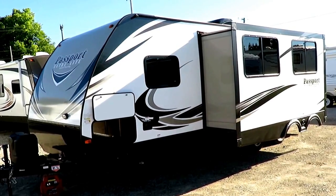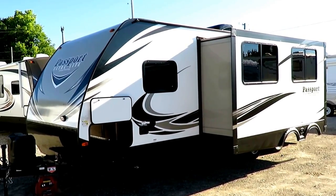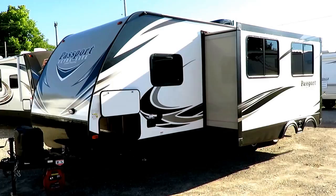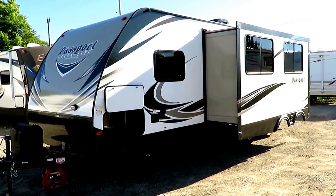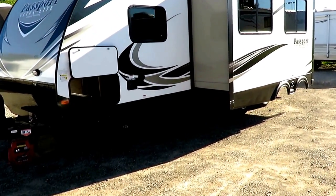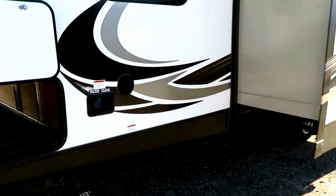This is an NXG aircraft-style chassis. It's made with HSLA steel — high-strength, low alloy. In plain terms, it's a Z chassis, not an I-beam. It's lighter yet stronger, not cheaper. You want a good house, you build it on a good foundation — that's the whole concept here, and it's proving accurate.